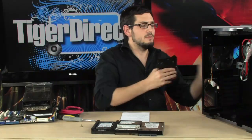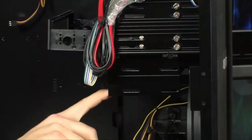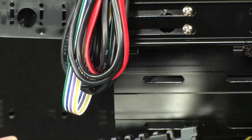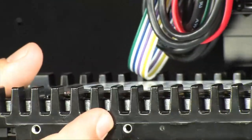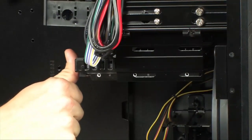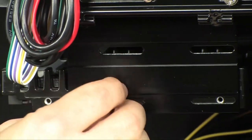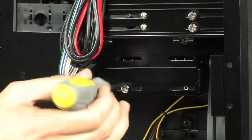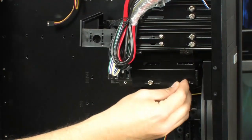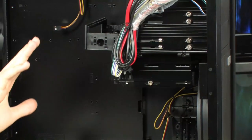Let's take a look at the inside of this case — this is an NZXT Panzer case. There are a couple of different places to put hard drives, but I'll show you this one here, which is what most cases look like. It's basically a little caddy that holds your drive. Most drives have little screw holes on the side, and that's how you secure them. You slide the drive in, the holes line up, and all you have to do is thread in a screw or two and tighten with a screwdriver. Some people use just one or two screws; you don't need to get too complicated.